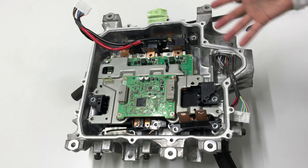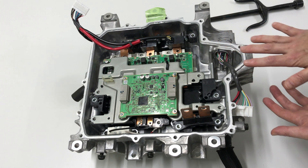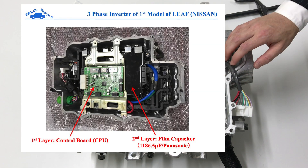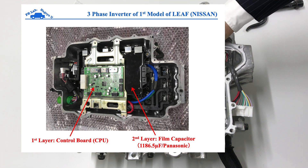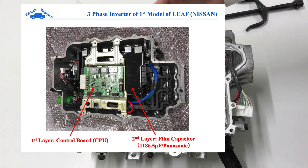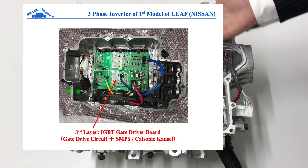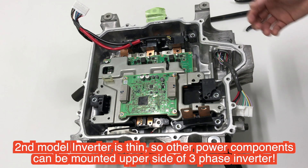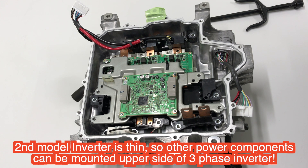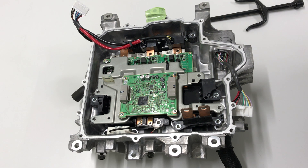For mounting in the PDM converter — PDM means the DC-DC converter and on-board charger — this layer is very low profile. In the case of the first model of the Nissan Leaf, the inverter module's upper side was mounted with the smoothing capacitor, and above that was the control side, so it had three layers: control layer, capacitor layer, and power semiconductor layer. However, the second model is mounted in only two layers, so it is very thin, and the DC-DC converter and on-board charger can be mounted in the engine room on the upper side of the inverter. That is all of the Nissan Leaf powertrain technologies. Thank you very much.